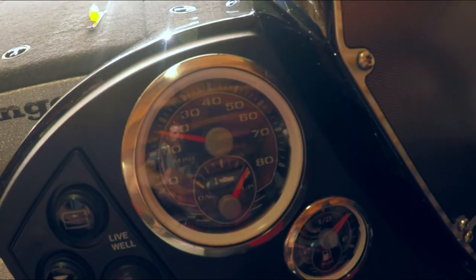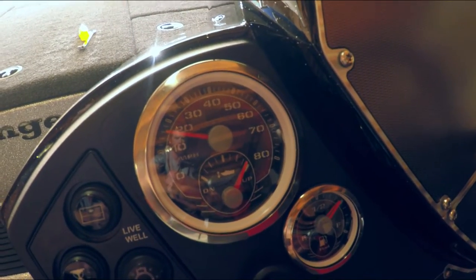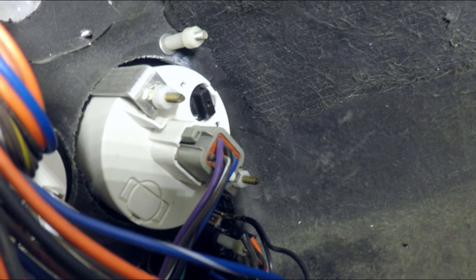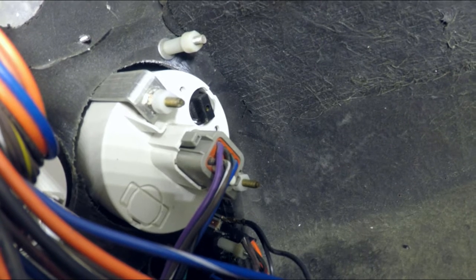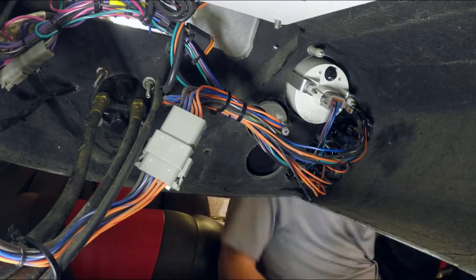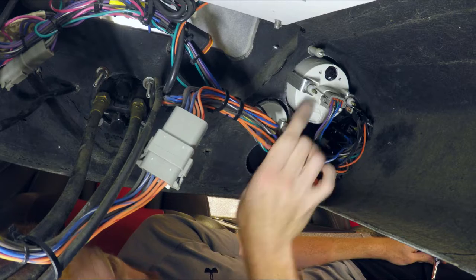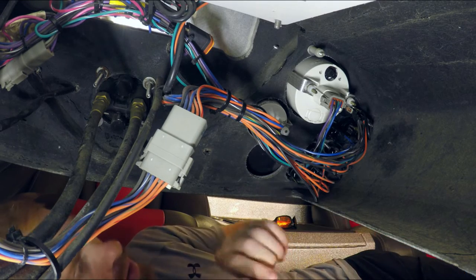Right there is the speedometer I'm going to be replacing with a Boss radio — I'll put the link in the description below for which one I bought. There's the back of the speedometer; it's just held in by two nylon nuts — after trial and error I found they are a nine millimeter — and then you take off those nuts and the main harness just disconnects.